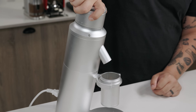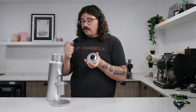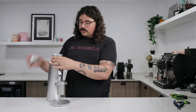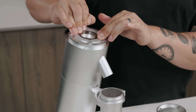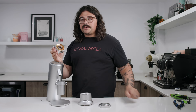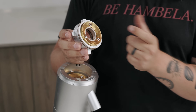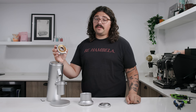The dialing does not feel great — it feels almost like metal on metal. Maybe it just needs food-safe grease inside, but it doesn't feel great. The top piece is removable and held by magnets. However, one of the magnets fell inside the grinder, which is not a good thing — it's metal and wants to stick to everything. You could destroy your grinder if you didn't notice it and ground with it. Inside you can see the top burr carrier held down by four springs, which you compress against when dialing by turning the top.